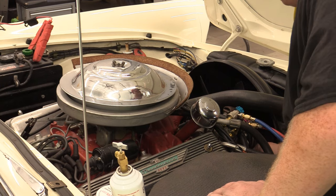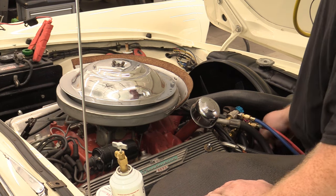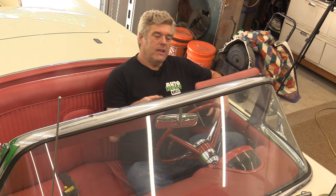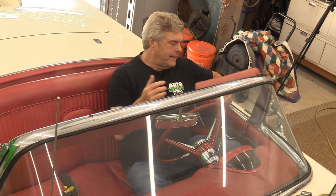These V-belts could use a different belt. This one's pretty small and it's way down in the pulleys touching the bottom of the sheaves - that's going to create a heat issue, especially on that compressor. You could actually burn up and throw a belt pretty quick. That pulley is blazingly hot. The compressor was squealing at about 1200 RPM, which tells me A, that's the wrong belt, and B, it needs the multiple sheaves with a single sheave that does a full wrap around the top, about half of that compressor.